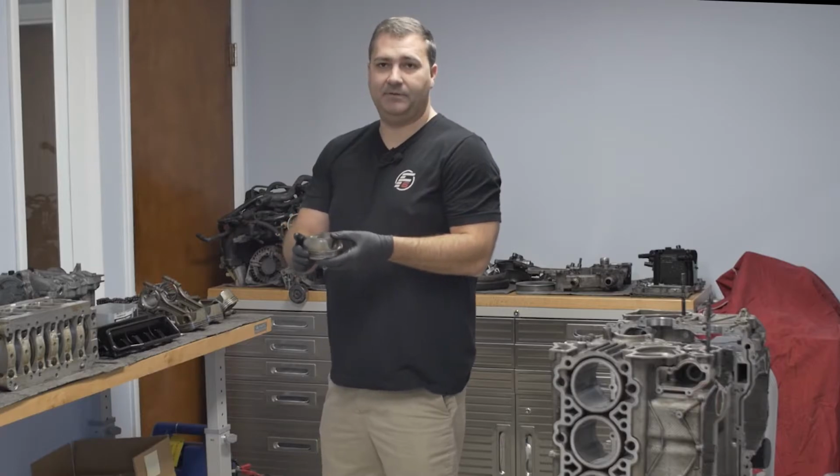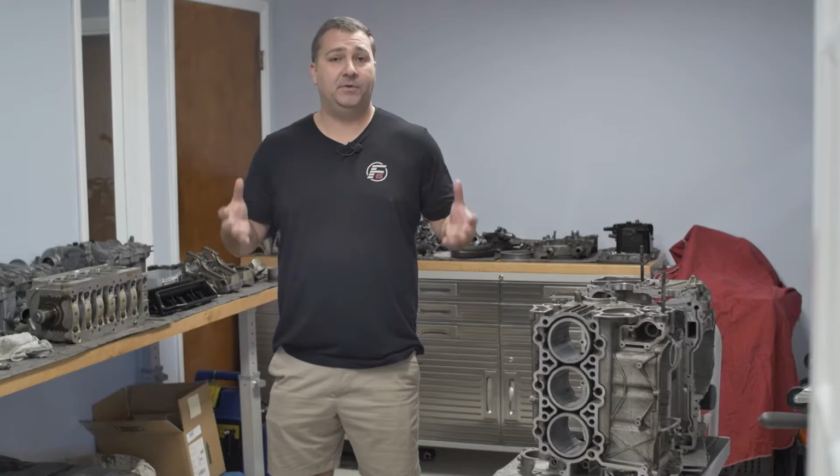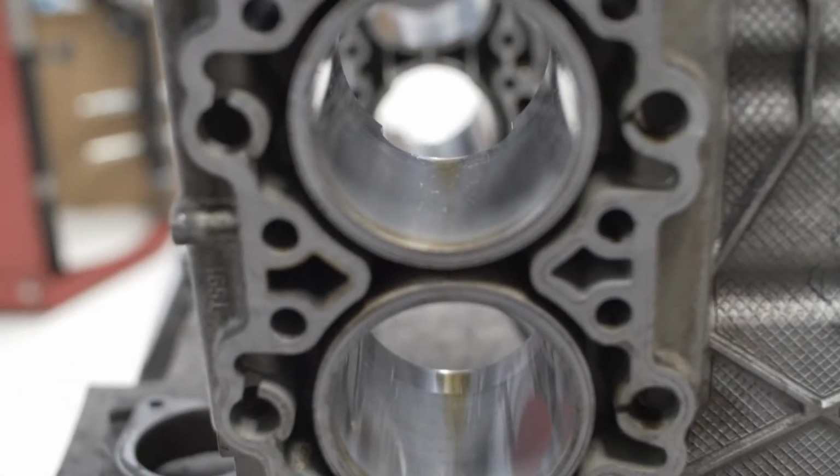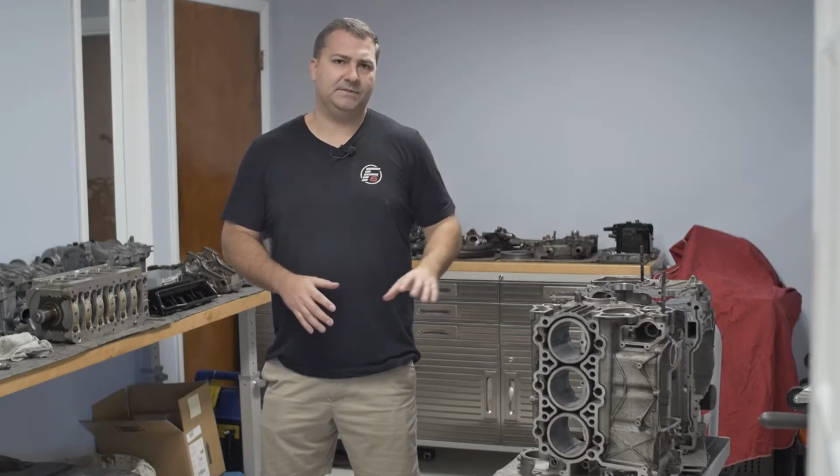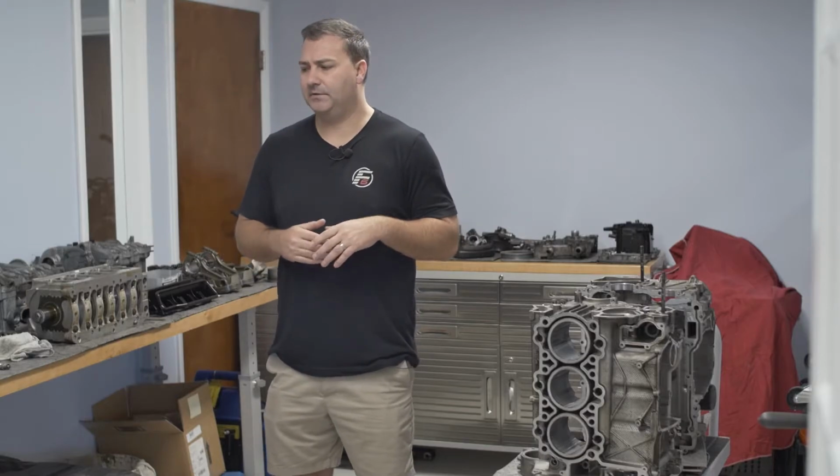And we like having fun, so we're gonna have some fun with this motor. All right, so with all that, we're going to build this motor. We're gonna send out the case halves, get those re-sleeved and bored. That's gonna be a 3.8 liter engine we're going after here. We're hoping to get around 350 or so at the wheels. The builder of this said that a similar setup has done 365 at the wheels, which is pretty impressive.